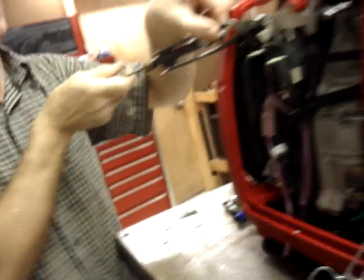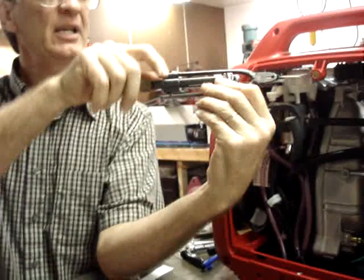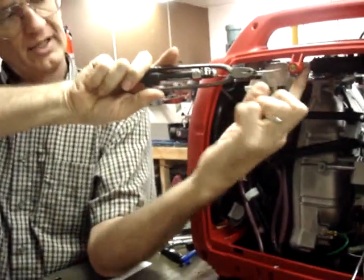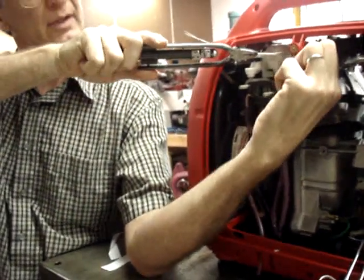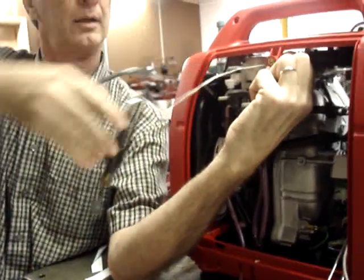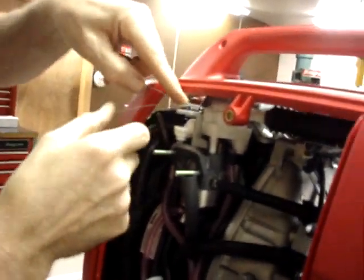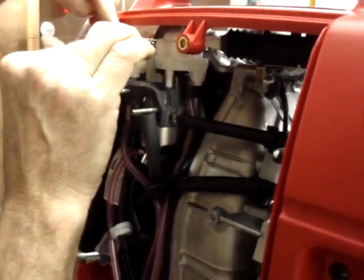If you have the safety wire pliers for this, go ahead and use them. If not, you can take a pair of vice grips and clamp it just the way I did, holding the choke actuator with one hand and twisting the pliers with the other one. Go ahead and twist your piece of wire, and then recheck your gap. This can go one more twist.